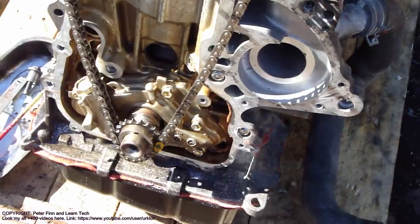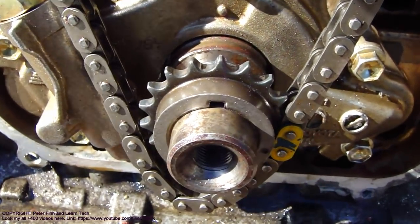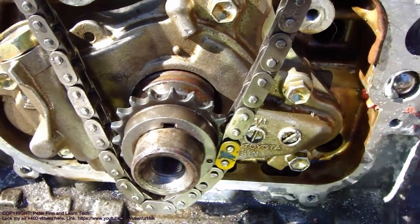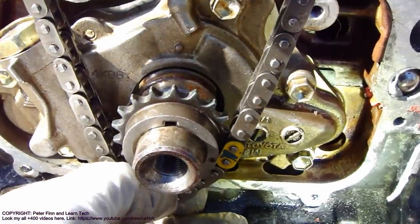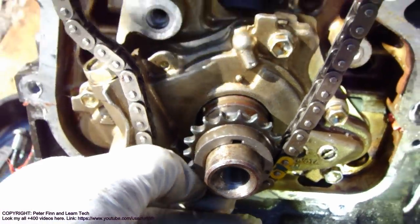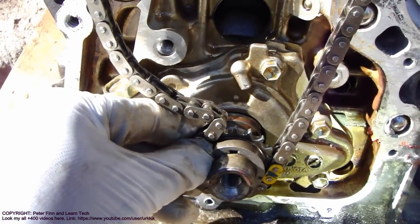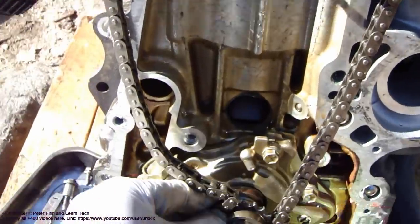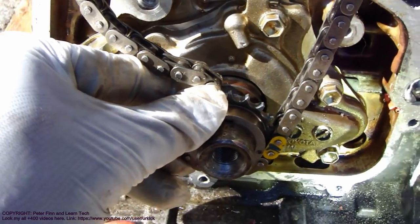Then I show this. I take the next picture, and in here this yellow mark must match with this pointing here. Yes, now it goes away, but I take it again, and now it matches, and then I keep my hands in here, and this is like the first pre-tightening. Okay, and now when this part is in here and this upper is in here, I need to keep both of those, then I can hammer this sprocket a little bit deeper in there, and I will do that next.